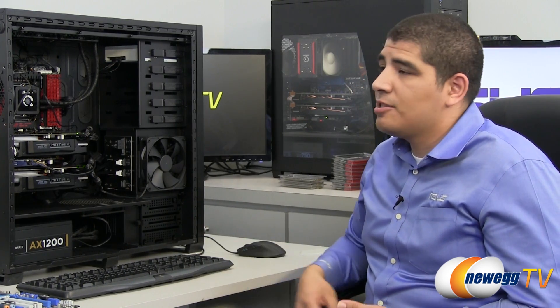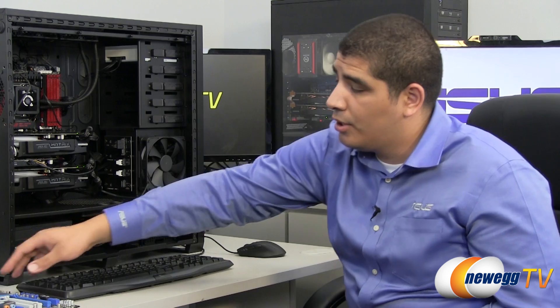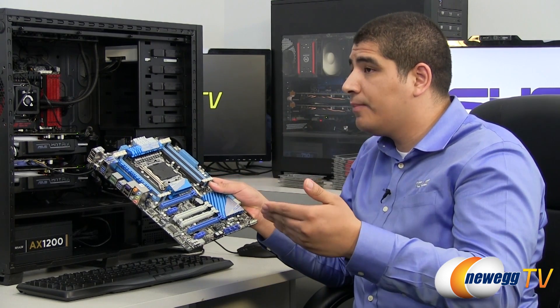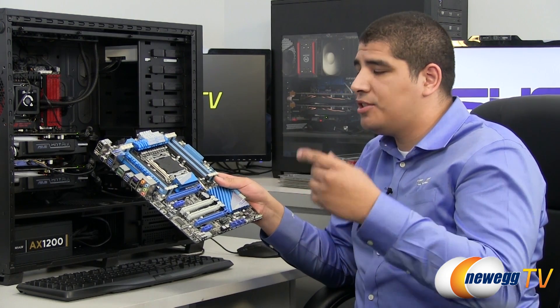Some updates could be much smaller and the system might repost very quickly within a normal POST cycle of maybe 10 to 15 seconds. That longer POST would probably occur if you were updating the BIOS via any other method as well, because it's dependent on what's included within the BIOS update itself. It's important to make sure not to shut off the board during that process. If you look at the debug code on the ROG board or the Deluxe board, you'll see the debug code is changing during that process even though nothing is necessarily posting, because it's going through different memory training updates and the MRC update. Once that completes, you'll see the board POST normally.